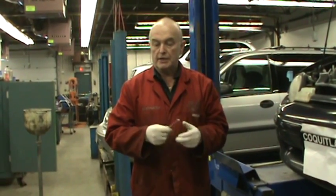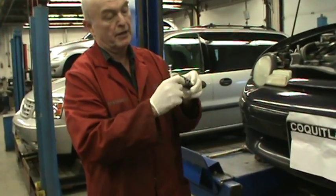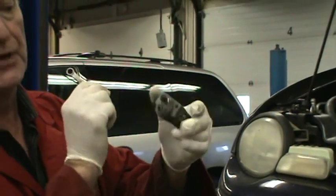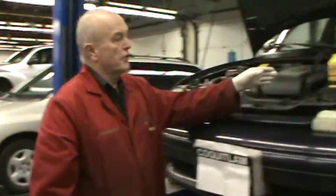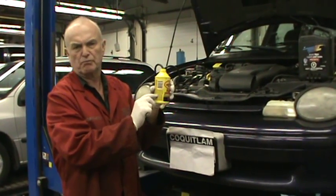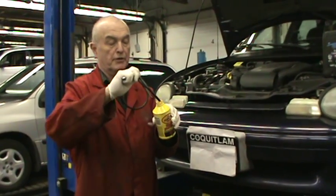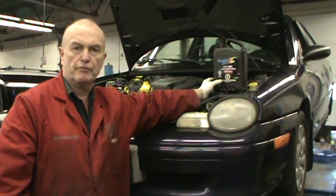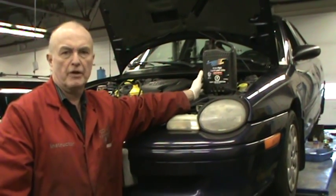What you need is the right wrench for the bleeders — the bleeders are on the back of the wheel cylinders because we're going to do rear wheel cylinders. The bleeder screw is right there, and this is the wrench for the bleeder. You need a proper size wrench selected ahead of time, a container partially filled with brake fluid — about an inch of brake fluid — a suitable rubber hose that will go over the brake bleeder, and the proper brake fluid. This one requires DOT 3 brake fluid, and we've verified that that's brake fluid.